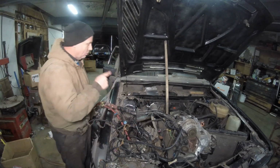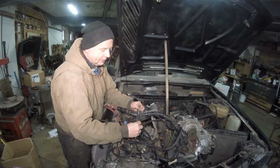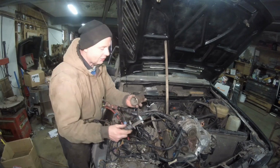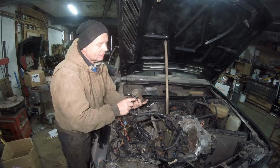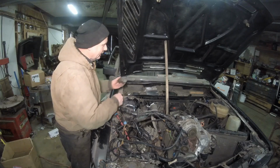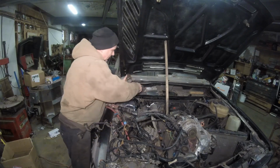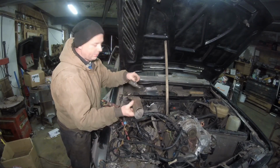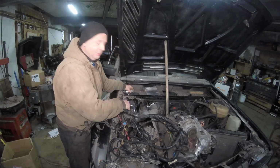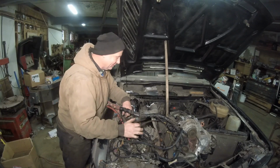Now, what I did was I initially measured up the internal part of the grommet. What do I have? Yeah, it's roughly 62 millimeters. You can't really tell with the floppiness of the rubber. I just got an exhaust pipe like that, and you go, oh, okay, that's actually 61 mil, something like that. I can just start grinding away and finding out that this thing will basically fit inside a hole that I grind out. That way it'll just go in, and then I know what it is. So that's pretty much it.